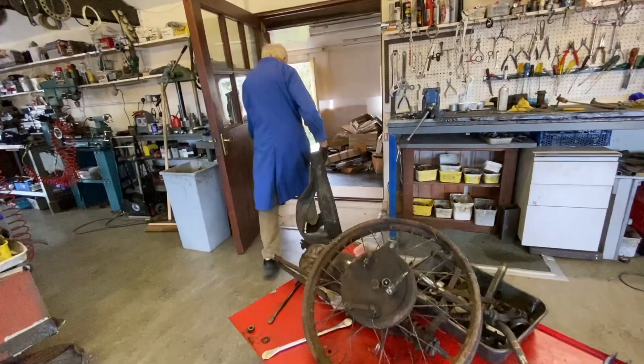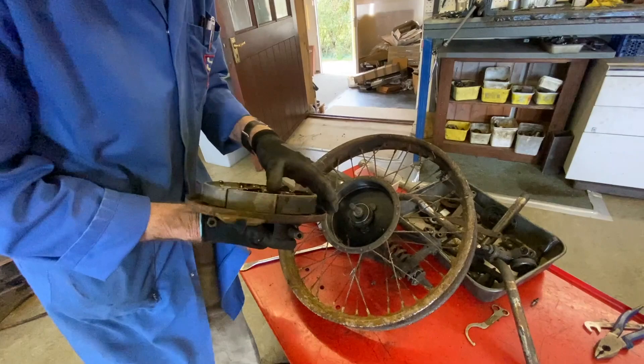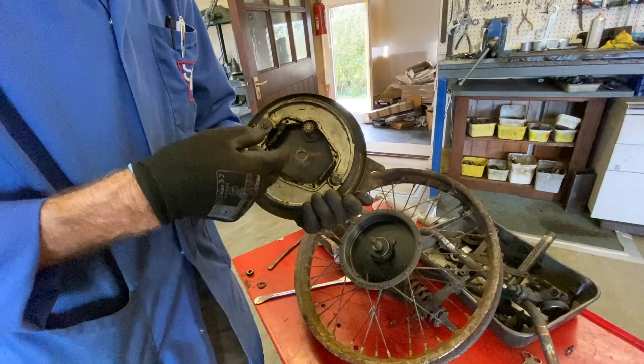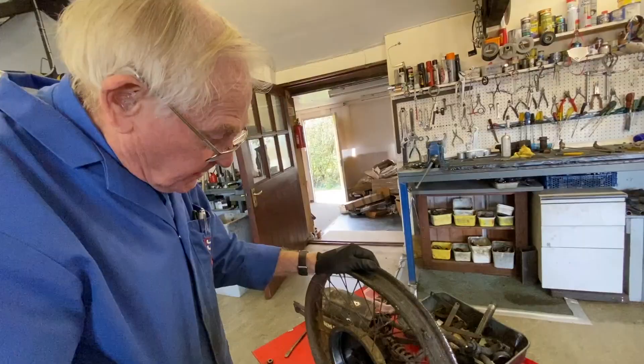There's not much life left in that — I think it's well past MOT certificate time. That's the drive for the speedometer. What happens is you've got a gear in here and a gear in there, and that rotates and you get the drive to the speedo cable — it's been calculated to get the correct speed reading. Brake shoes: well worn out, well past their best. So we'll get those off to a relining service over in Cardiff.